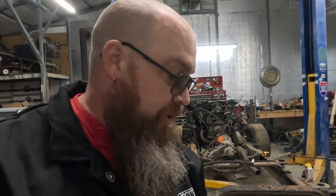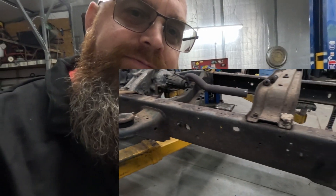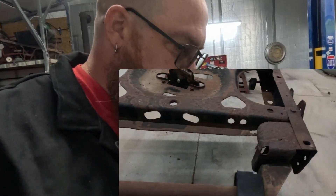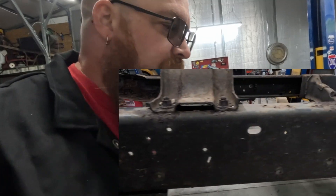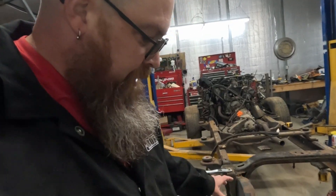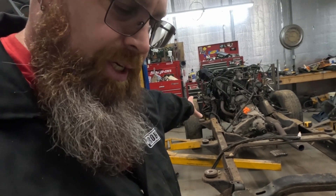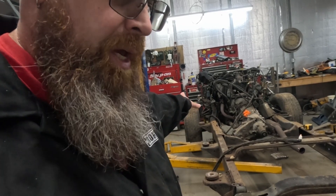Today is the day we are going to cut the back half of the frame out of this Dakota. If you watched our channel update video, I did a little walk around to show you some of the rust we're contending with. It's a common problem on these frames where they rust out where they're put together. The good part is the frame rails going out to the front are still in good condition — I've already repaired all the mounts for the front suspension in a previous video.